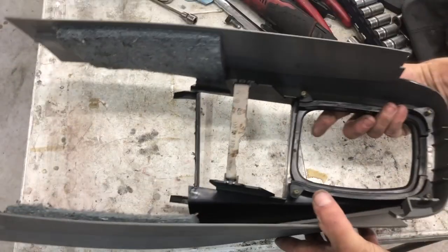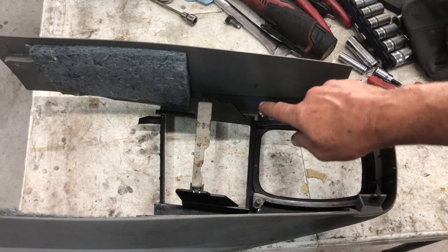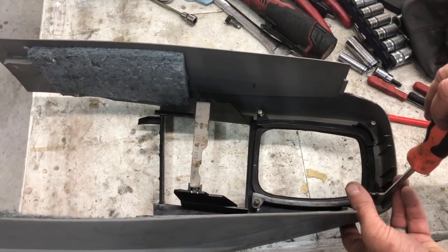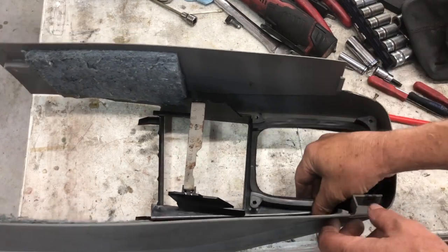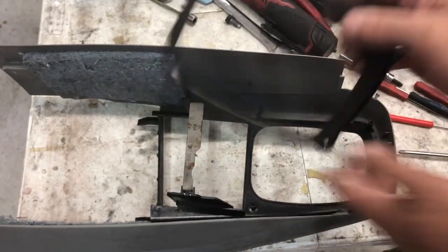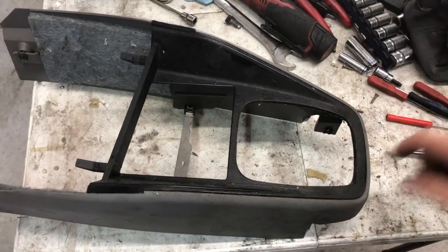So be a little bit gentle with this thing. If you flip it over, when it's in automatic configuration, you'll see there's 4 little screws there. Take those 4 screws out. It's just a Phillips. They may be Torx on some cars. And there's 2 pieces that will come out. And that's the adapter for the automatic shifter. Now your new shift boot will fit correctly.